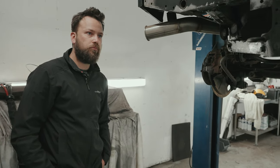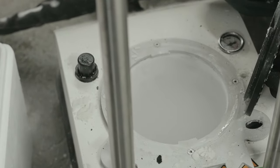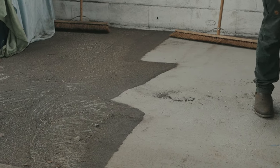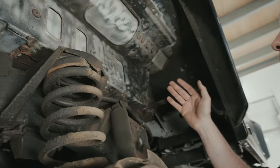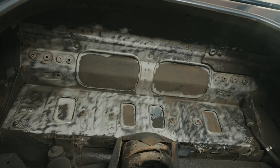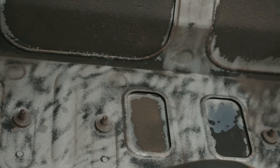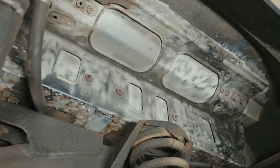I've noticed — I know it's ice — but it doesn't feel like conventional ice, it's not cold and wet. Look at the floor, there's just no moisture. That's one of the wonderful things about it — the dust you're taking off just falls to the ground, no wet surfaces. Back to the recycling thing — being kind to our planet — normally I'd have someone under here with a wire wheel for a day and a half. We've used less electricity, less manpower, and less of everything really. Now this just needs a good cleanup with some fine sandpaper and should be ready for paint.